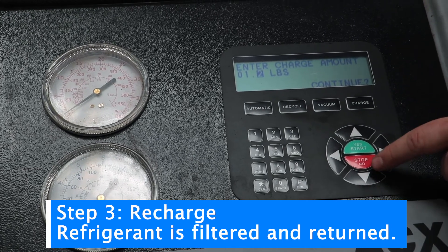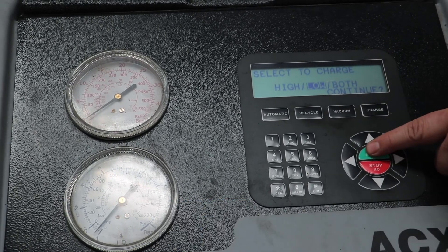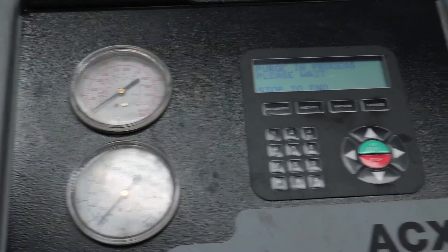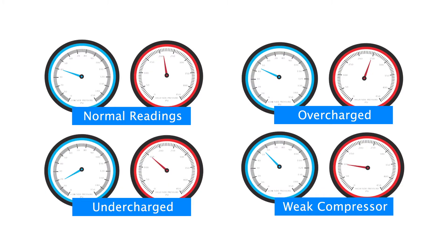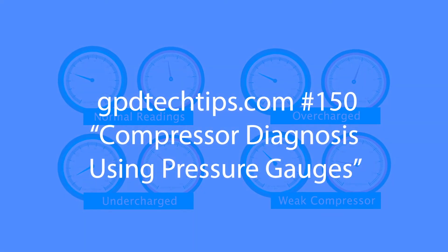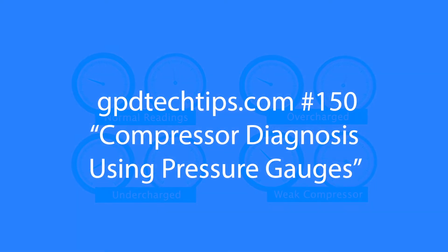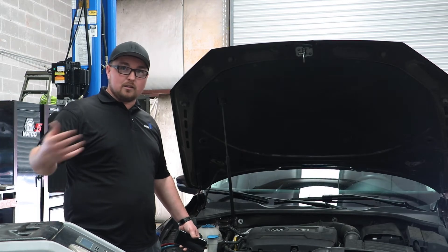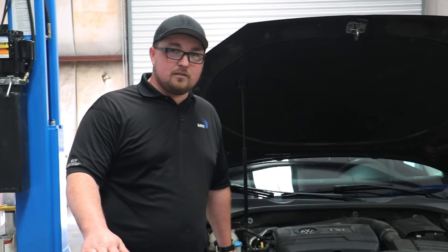Now that the Freon is going into the system, you need to start the vehicle and turn on the AC system. Watch the low-side gauge — make sure it's pumping down and cutting off. If it pumps down too far into a vacuum, you've got a blockage. If it's not pumping at all and just stays equal, hook into the high side and watch that pressure. If the high side is the same as the low side, your compressor is coming on but not actually pumping — that means the compressor is no good. It's very important not to bump the machine while charging, because it is going off of weight.